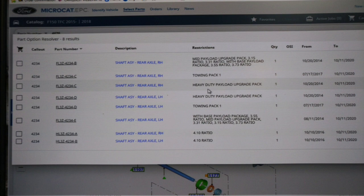Now, if you had an 8.8, which comes with the low towing axles or the low axle weight rating, you could insert these heavier internal axles to make your axle stronger for twist, but that's still not going to increase the rating of the axle assembly, because the axle assembly is rated on everything including brakes and the tube wall thickness.